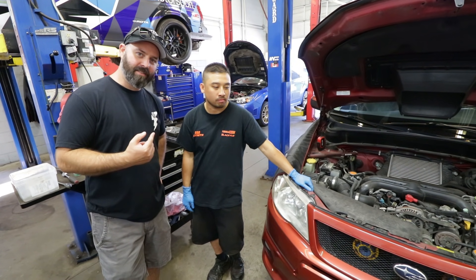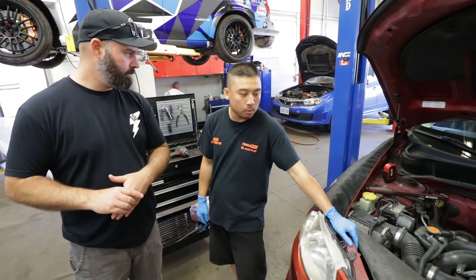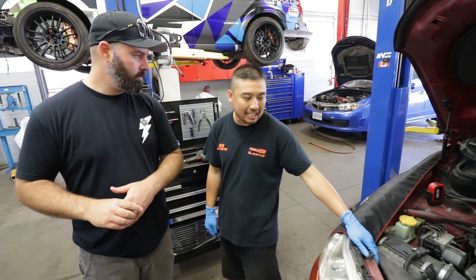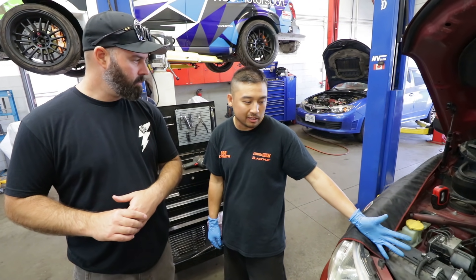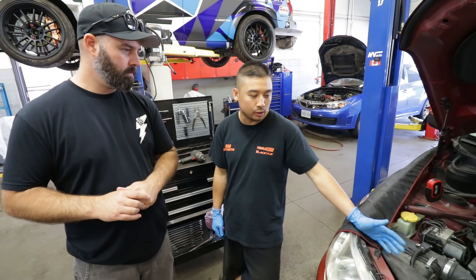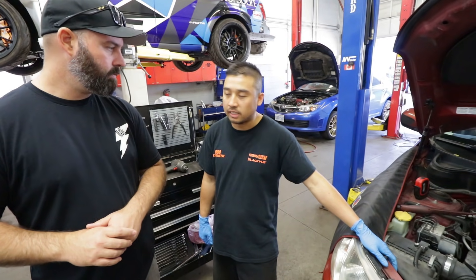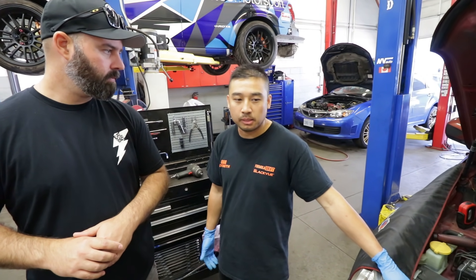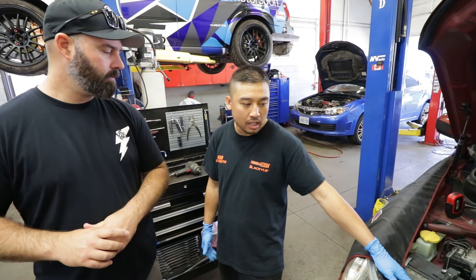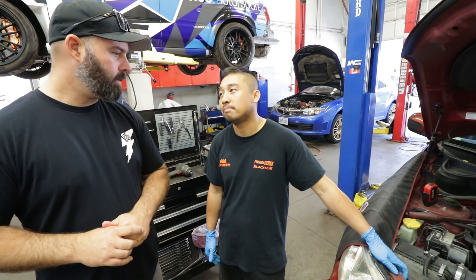This is Nam — he's going to be spinning the wrenches today. Nam, what models of Subarus does this job apply to? Most dual cams first came out about 1996, and they still reach all the way up to about 2018, with the new STI still using the same engine — so about '96 to 2018. There are some differences between this and the single cam setup: the belt's a different size, different components, different water pumps, and some idlers are different. But pretty much it's the same thing — just a little less components on a single cam.